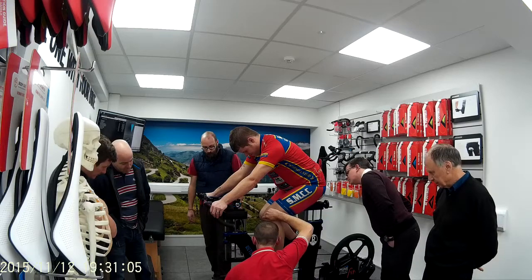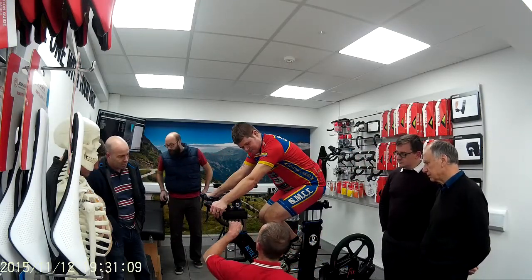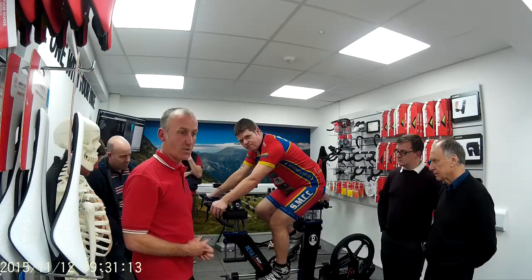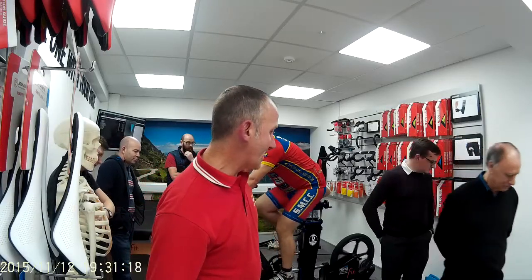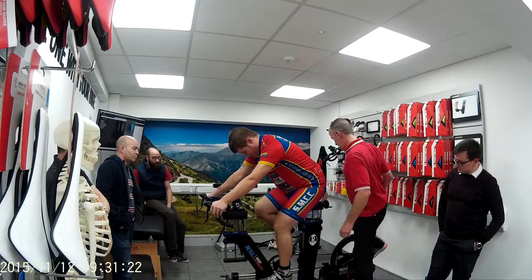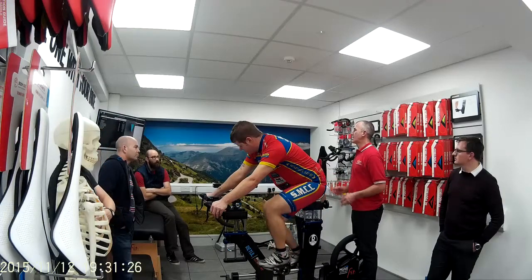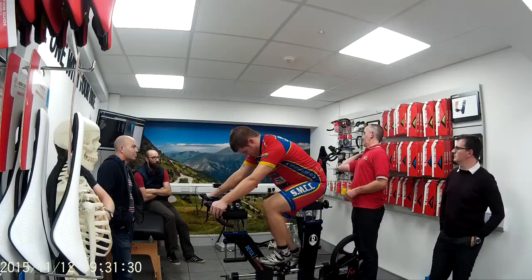But you'll have your bike here, so I'll be moving the rails on the saddle. So we know we'll have him in a far better place, so we're not going to get an injury. This is me fitting you by eye. That's what you guys need to be doing as well. This will get you in the ballpark. Most bikes have the option to move it enough, back and forth. You can't ride my 54 without having to do a bike fit like that.